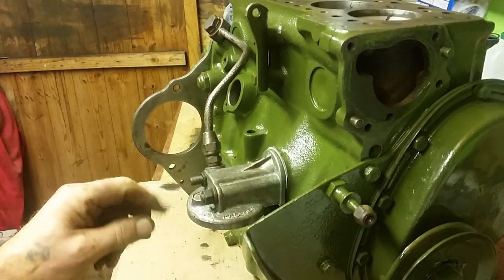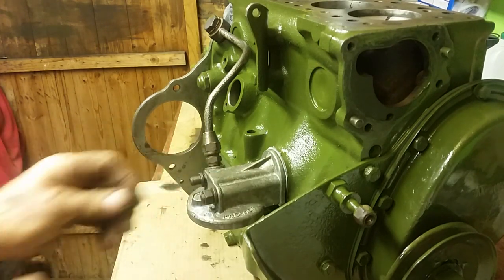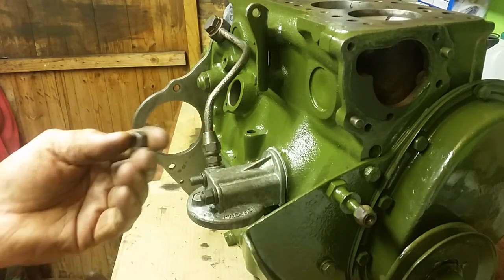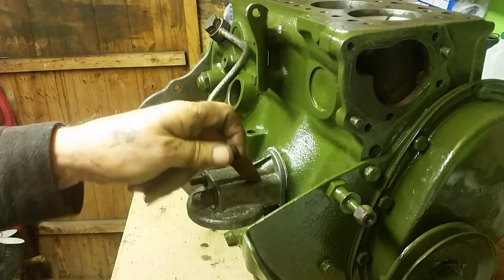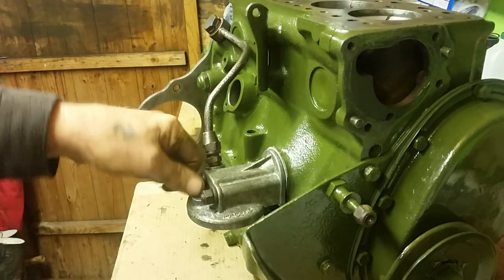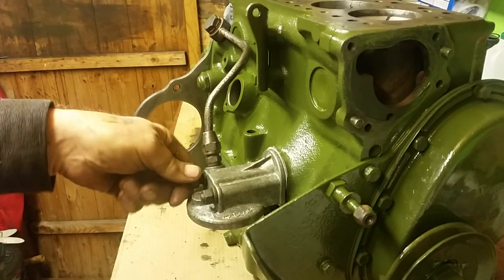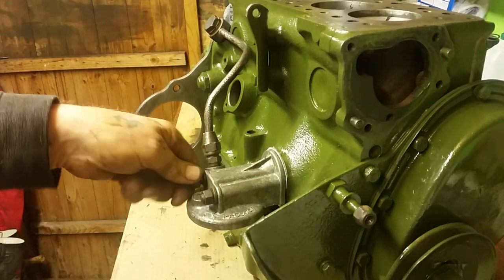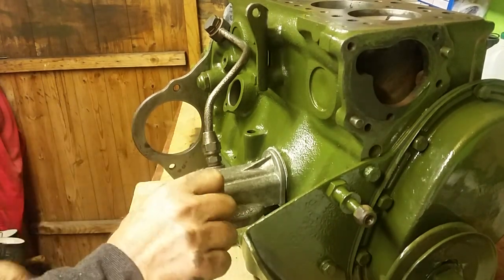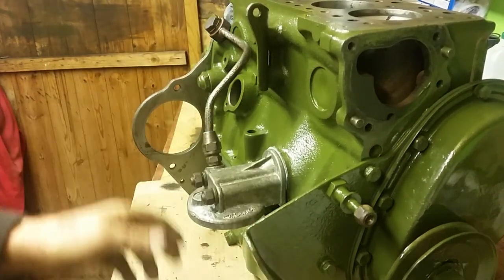As you probably saw in the earlier videos, I had those washers and these two nuts screwed onto the studs. Even the threaded bolts can be undone and replaced if you've stripped them. Tighten them up nice and tight with your fingers. I am going to tighten those with a socket, but not right now. I can never emphasize enough: always do these up finger tight first.